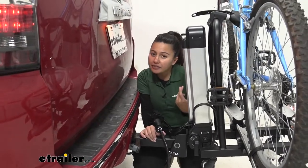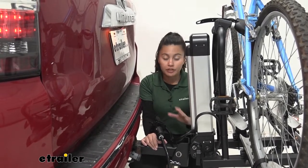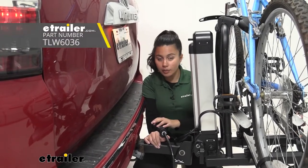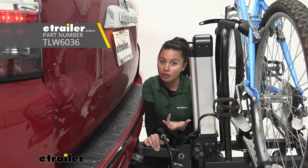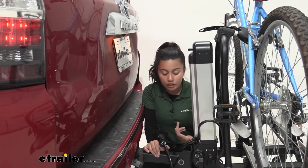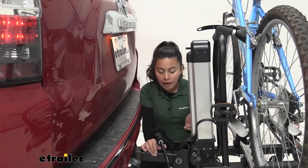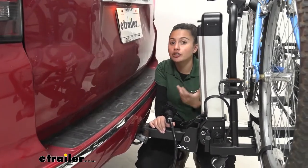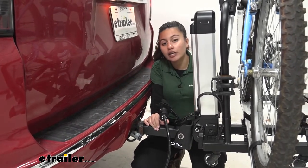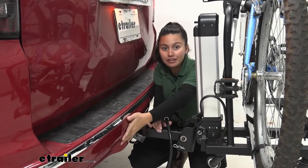With the 4Runner, you have different options for adapting your wiring. What I did was get the Torque Lift extension — a 7-way extension designed for special Torque Lift hitches. Because of its unique application, it's on the pricier end, so it's probably not worth it just for this bike rack. Another option if you're mechanically inclined is to use pretty much any 7-way extension — those are usually 4 to 8 feet long — and adjust it yourself so it fits perfectly between your bike rack and your vehicle.